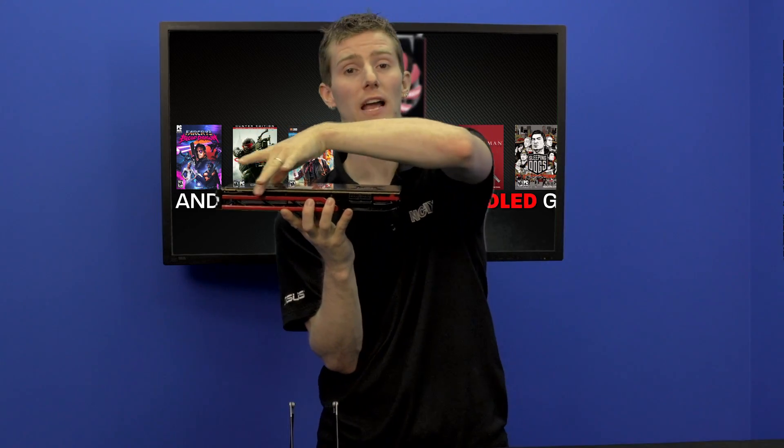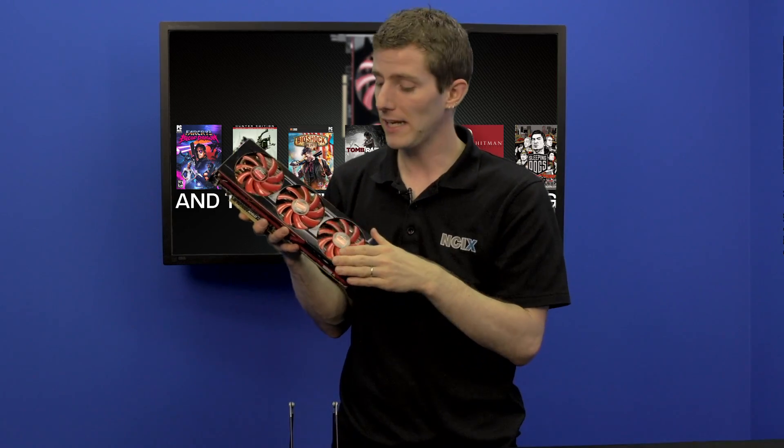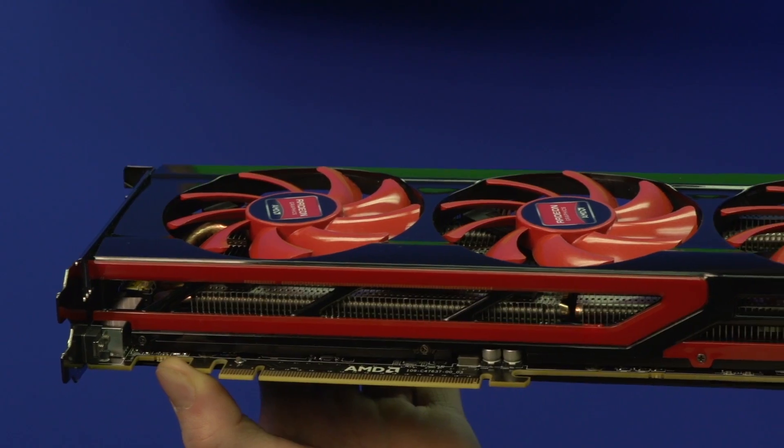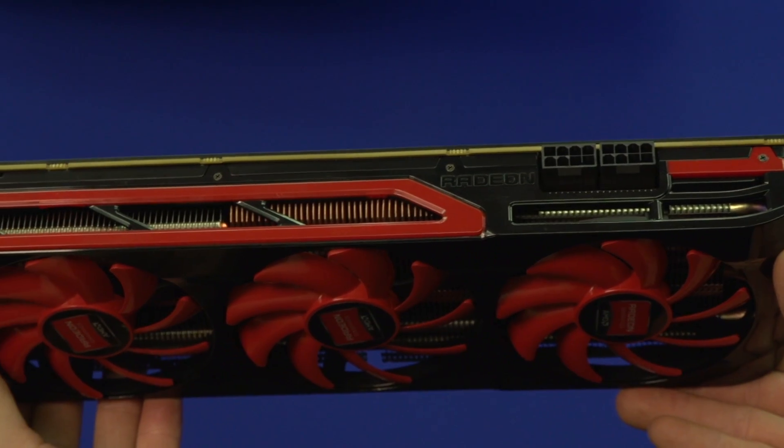Many gaming cases spec out how many inches of space they have for a graphics card. The other thing is make sure your case has adequate ventilation. Previously, most reference cards used a blower design that outputs most of the heat from the back of the card outside the case, allowing them to be used in cases without great cooling. This one is not using that design — most of the heat is exhausted from the top and bottom of the card, meaning it stays inside your case. So if you don't have enough case fans, you might run into problems with the rest of your components. Your graphics card will stay cool enough because it's got like eight pounds of metal on it. Exaggeration.